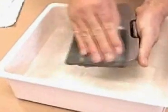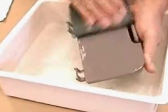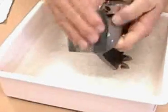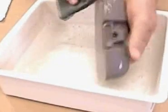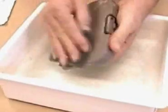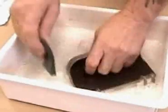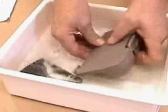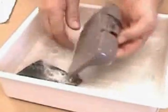Clean the part completely with a cleaning agent or by washing the part with a detergent-type cleaner. Use the scuff pad that's provided in the kit to help clean and break the surface of the part for better adhesion. Do not use an aggressive cleaner that may harm the part. It's a good idea to test a small area of the part prior to proceeding.